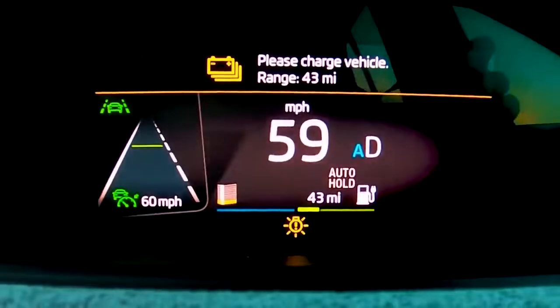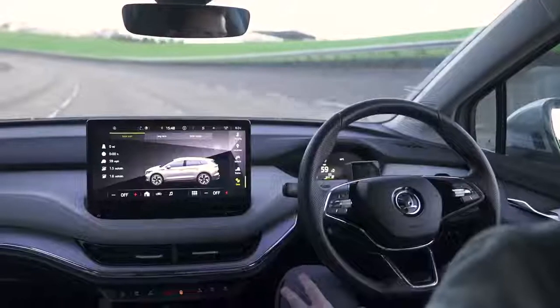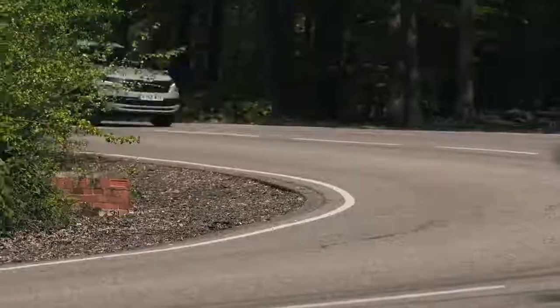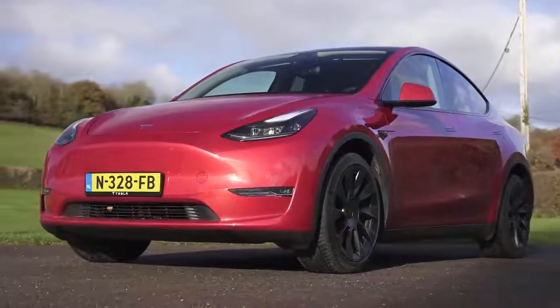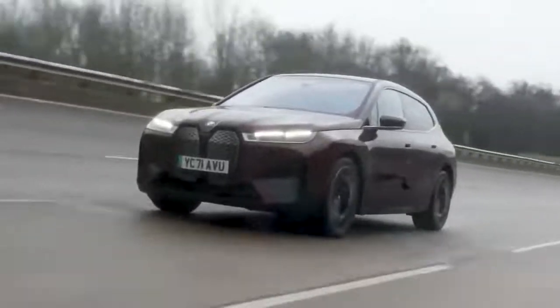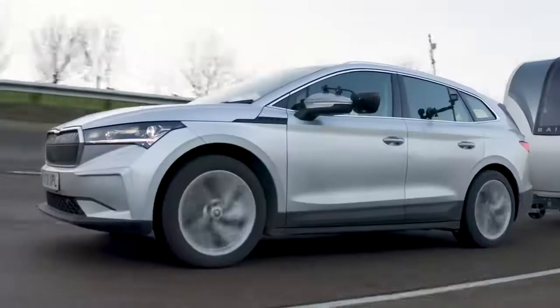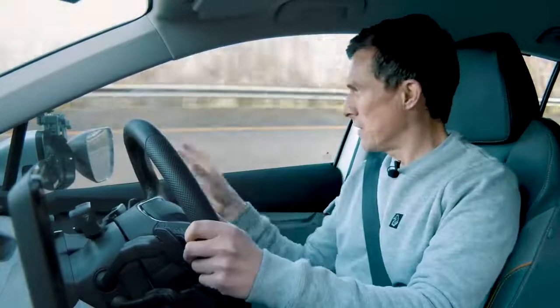Just as that happened, a warning appeared saying please recharge the vehicle - we've gone through our charge very quickly today doing all these tests. But I've got 10 more miles to go. If I had the four-wheel-drive version of this Enyaq I could tow up to 1,200 kilograms. A Skoda Kodiaq would tow two tonnes. But some EVs do better - the Tesla Model Y tows up to 1,600 kilos and the BMW iX up to 2,500 kilos, though the iX is quite a lot more expensive.